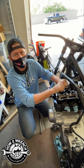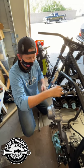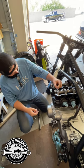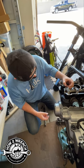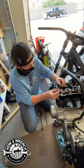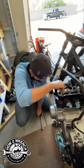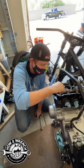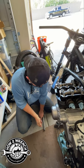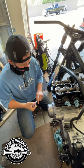These are way over-tightened. I'm actually a little concerned about this — I think there's a really good chance that might have been a three-eighths wrench, or the wrench just gave more than 96. Maybe from our guess it's more than 96 inch-pounds on these. I'm gonna go ahead and torque this to 96 and see how it feels. You and I've talked about this — feel is hard to teach. It's all experience.